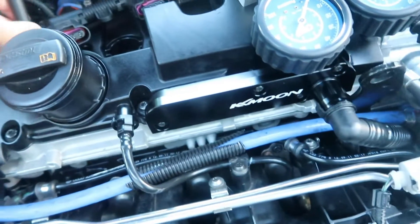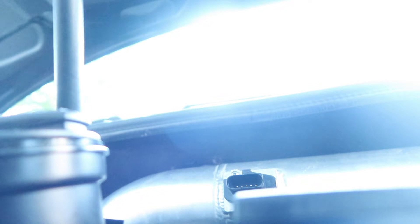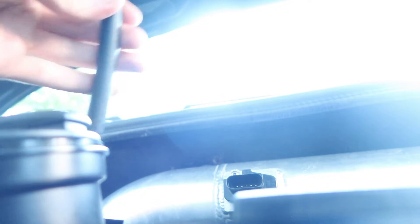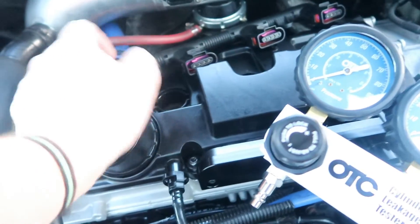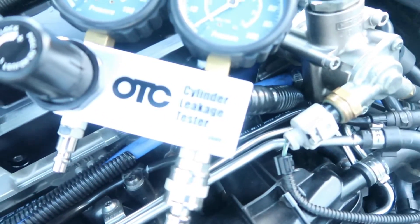So here's cylinder one first. This is the driest looking cylinder. It's pretty much impossible to get on camera, but cylinder one barely has any wetness to it. It doesn't really look wet on top of the piston, but two, three, and four all look wet — the pistons on two, three, and four have like a wet look on the top, whereas number one looks pretty dry. I'll see if the results of this test correlate with that.